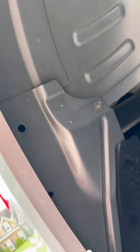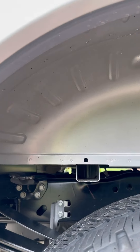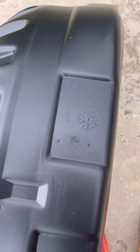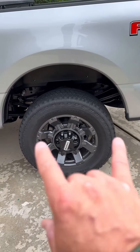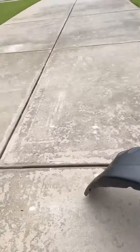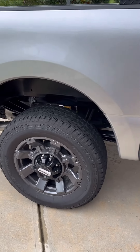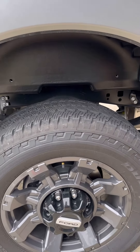You can see these little pre-punched holes all along the wheel well, ready to accept this. Even though I don't have clear instructions, it's kind of straightforward. Just completely ignore what I said earlier — right hand means the right-hand side when you're looking at the truck from the back. How do I know that? I spent a good two or three minutes trying to get the liner on the other side and my holes weren't lining up. For your RH, that goes on your passenger side; your LH goes on your driver's side. If you have the correct side, they should pop in pretty easily, and you can see my holes are already lining up.